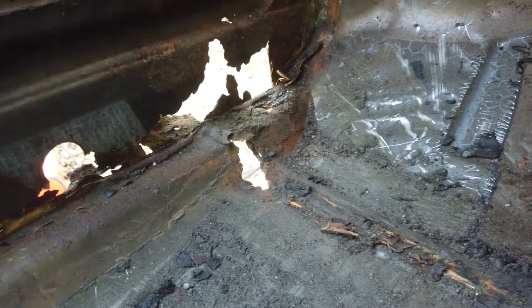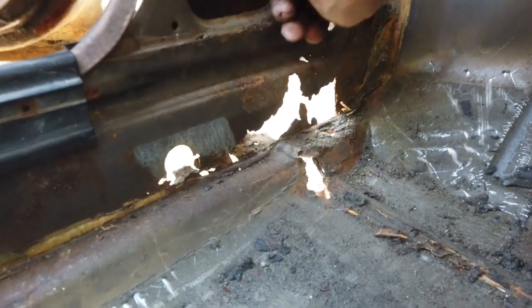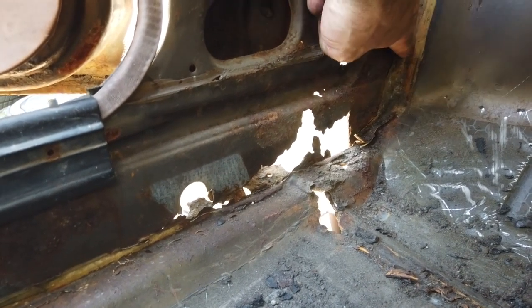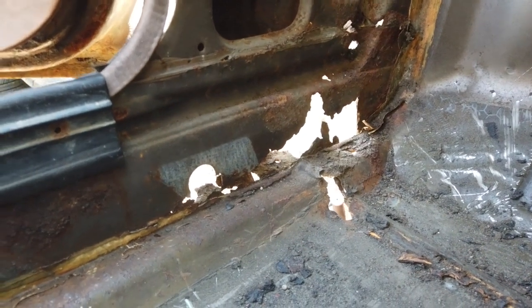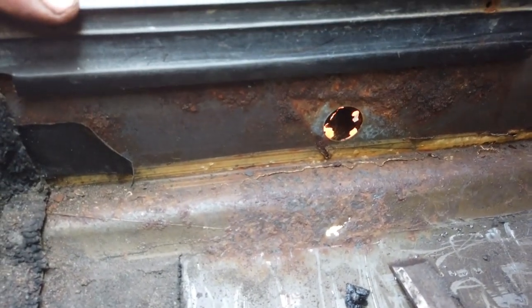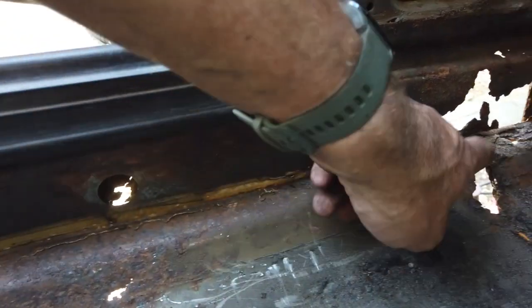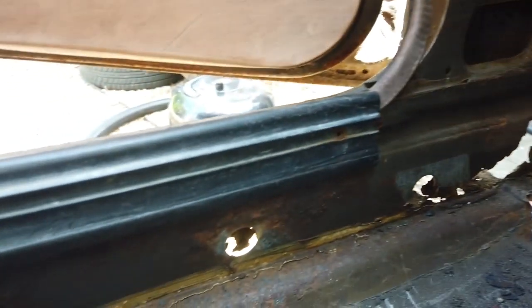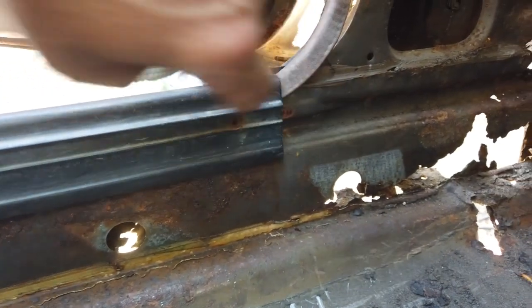We may as well keep that shape. Where it joins the two halves of the floor - the lower bulkhead to the floor pan - that's intact. So all we've got this side is slightly better then, although more rot on the inner sill - that doesn't really matter. The entire inner sill section needs to be removed right up into the nose. So: more heat, more sealant to get out. This is an extraction job - cut a vertical cut, take all the spot welds off that top lip, and surgically remove a section of the inner sill. We've got a lot of good floor section here - we're only going to need a small angular repair piece just at the front.